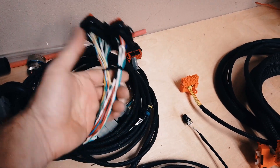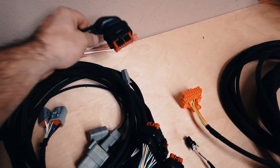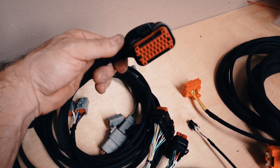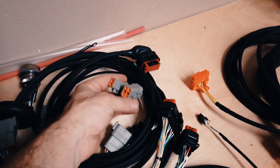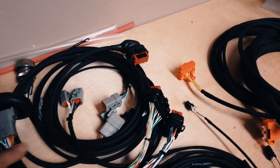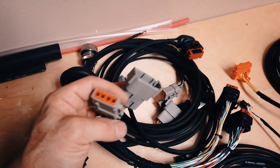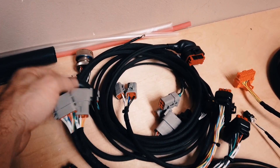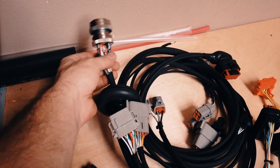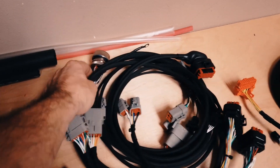There are two sets of these harnesses - one per full pack. Then we have the thermistor packs. This wiring harness right here is for our rear PDM, which will go into our PDM-30 rear PDM with a similar style connector. This one is going to interface with the Tesla drive unit. We have some stuff under the car for water pumps, water pump controls, and then some interface plugs to our main harness. This is a mil-spec cannon plug that's going to go into our high-voltage box.